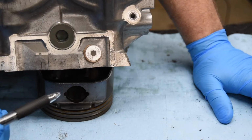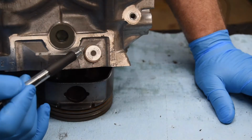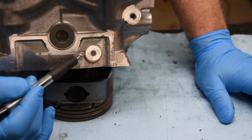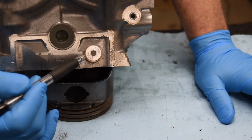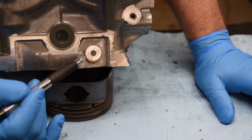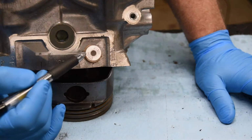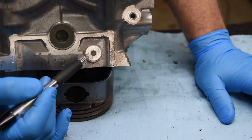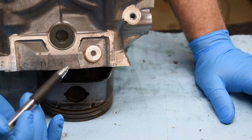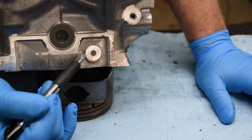So before the cylinder head goes into the oven, I just wanted to point something out. On the end of the cylinder head, there is a tab that's been adhered to the casting of the head. And this is usually installed by the salvage yard that you bought an engine or cylinder heads from. Or if you've had the cylinder heads rebuilt, they'll install one of these tabs right here on the cylinder head casting. The reason it's here is for them, on their warranty concerns, to see if the cylinder head has been overheated.